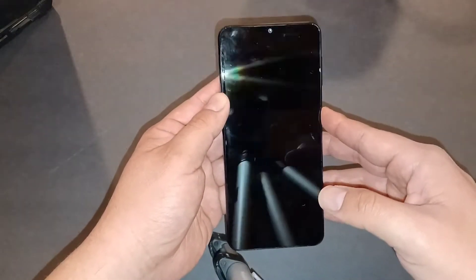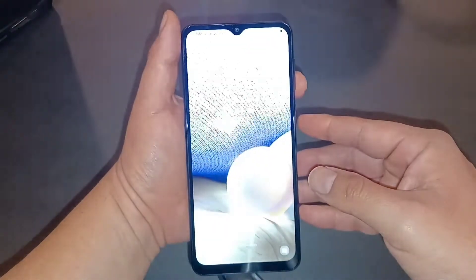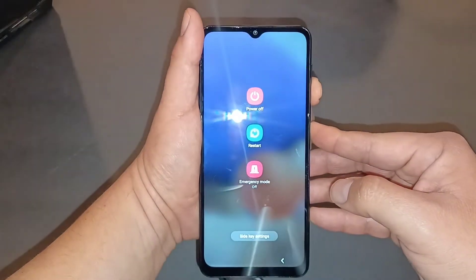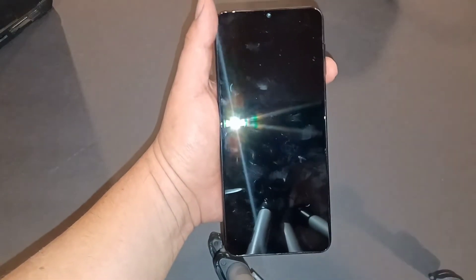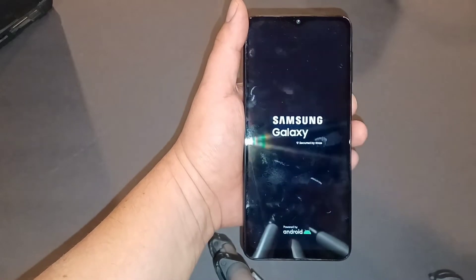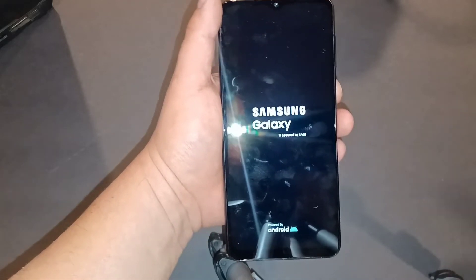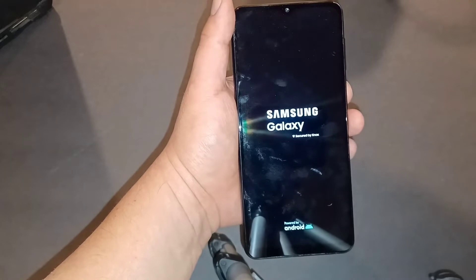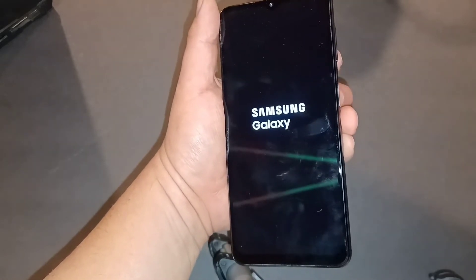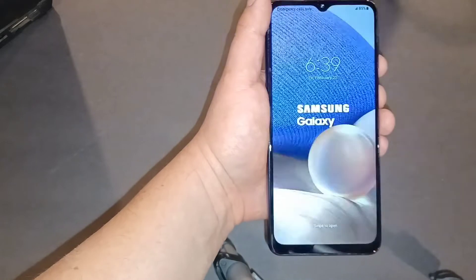If you want to get it out of this frozen mode, the easiest thing to do is press the volume down and power button at the same time. Keep pressing it and then just wait — it will turn on by itself and reboot the phone. So again, that's the first tip: volume down and power button at the same time. If you hold it, it will turn off the phone even if it's frozen, or if you have a Google account lock and can't turn it off normally, just keep holding volume down and power until the phone turns completely off and starts rebooting.